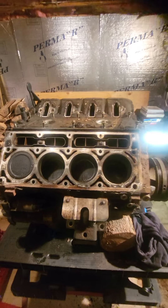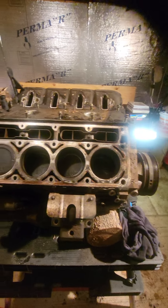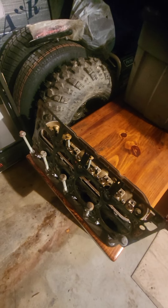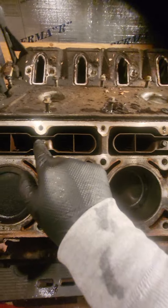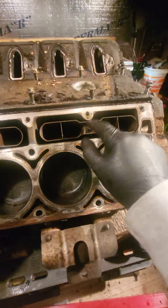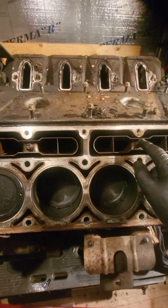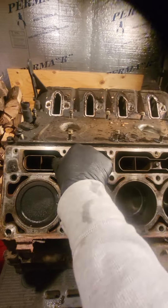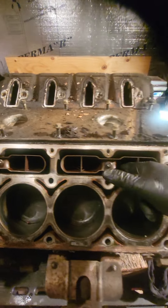Passenger side head is off — there she goes, right there with the gasket. Not that complicated. Next would be these lifter trays — take these two bolts out here, we'll slide these trays out straight up, and our little friends would be underneath there: our lifters.